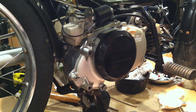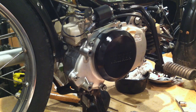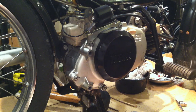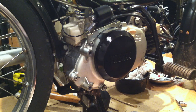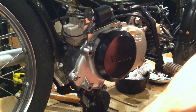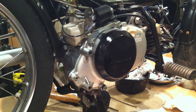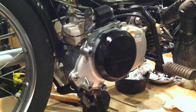I might go with a SHA clone carburetor instead of the stock carb. Carl's got a blue QT50 — maybe in a week or so we can get on film our little tête-à-têtes on the roadway. He might have some secret upgrades; I've revealed all my upgrades to Carl because he will be watching this video. He won the first round — we're about the same top speed but my acceleration is terrible so he beat me. I was overjetted, among other things. I will correct the jetting and I've begun to correct the acceleration with these clutch springs.